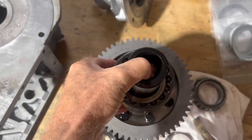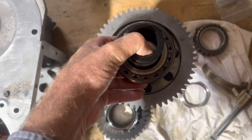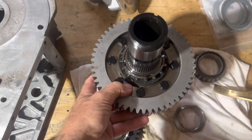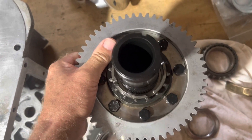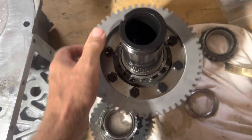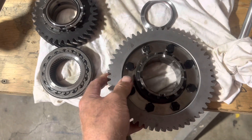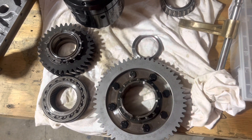This all comes off. You'll see the thick dog teeth there and the bolts in here. This is actually the original prototype — the very first low-range gear set built by Maxi-Drive. What they did was use the core of a factory low-range output gear, machined everything off that, and made a new outer from EN39B case-hardened gear material. This has run in Mal's car for many years as a proof of concept and is still going strong, as you can see, in excellent condition.